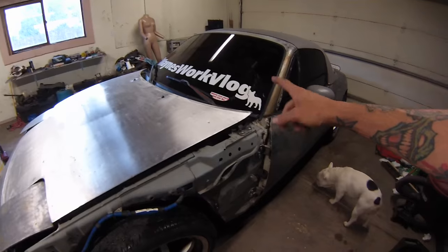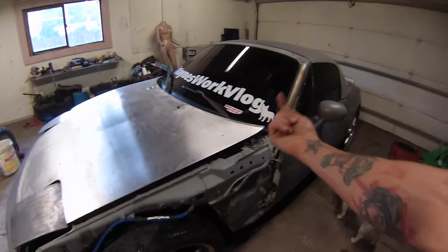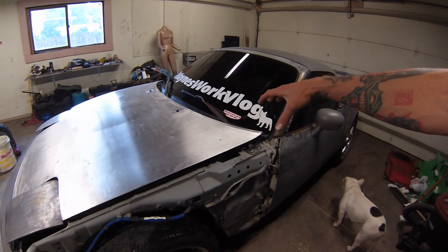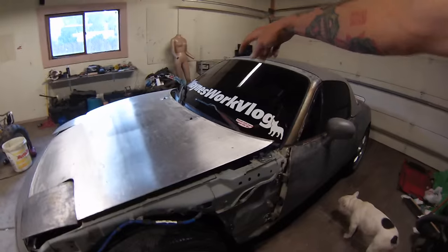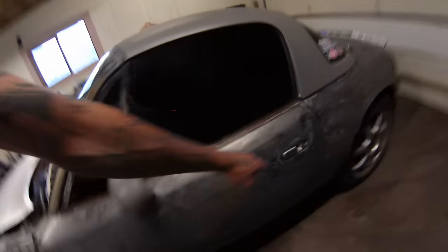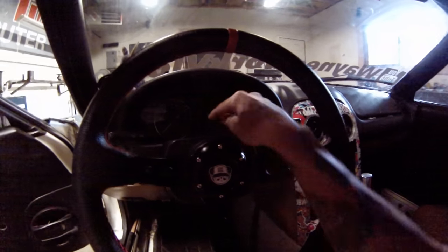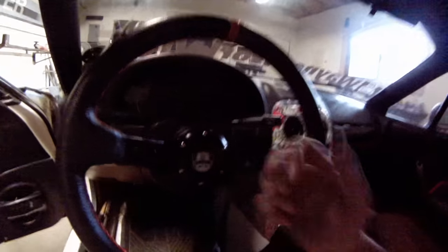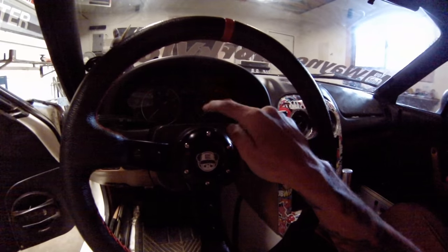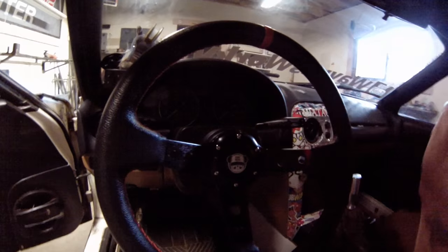What we're going to do today is remove the sensors and I'm also going to show you the airbag control module. On most models - I think 94 and older - it's under the dash right on top of the steering column. On 95 and up it's inside the actual dash, so you have to pull the dash to get it out. What you really want to do is either put some tape over your airbag light or pull the cluster - don't just pull the light bulb. Shine a flashlight on the front to see where the airbag light is, remove the light bulb, and that'll stop the blinking - but you're still going to get a beeping sound from your airbag module.